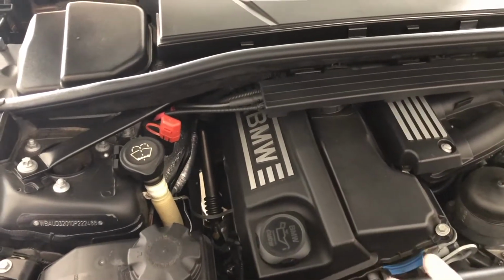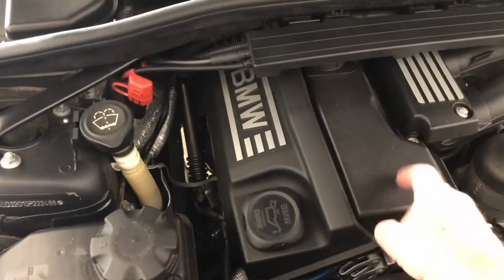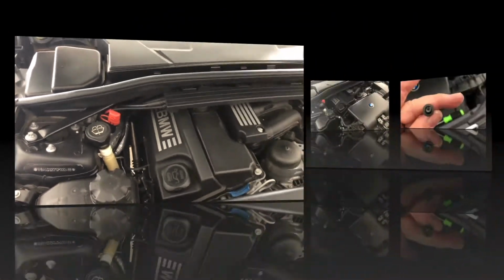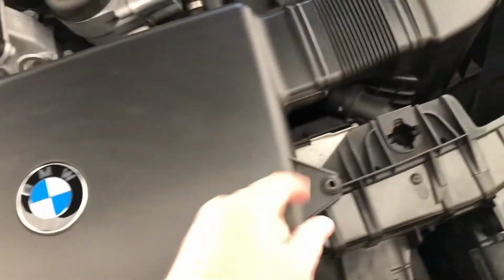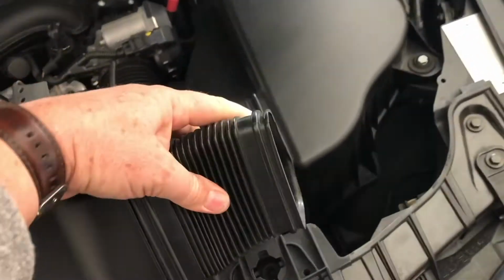That then comes off, and then we're actually going to unbolt the tapper cover here to go down to the next level. T20 Torx screwdriver required. Take these two out, and then this just lifts up. As I said, it pops off there. That rubber bit pops off. This just comes forward, comes out. Step one, and that's going to give you all that space here to get in and do what we need.